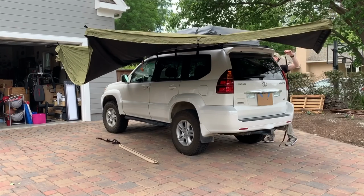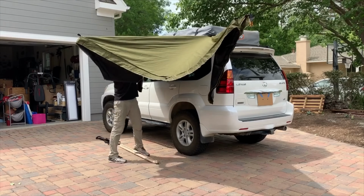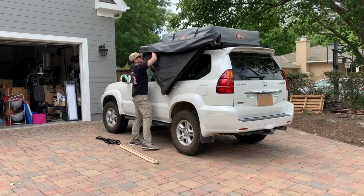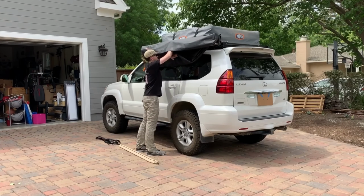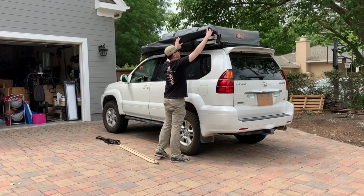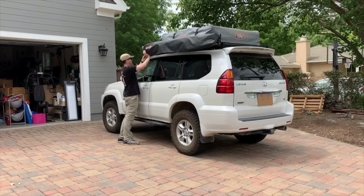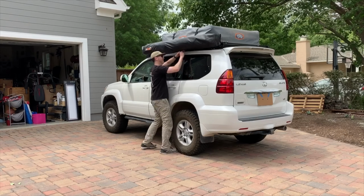There is an order to it, so you've got to obviously take the straps off that are holding it taut. But then in terms of the support bars themselves, you start with the left side because they go behind everything, and then you do the right, and then you just want to make sure there's nothing clumped up. You fold it up like you would a tent, really, and roll it all into the top, and then you take the additional pieces, like the extra support beams, and stick that up there as well, and then you zip it. The only other hint is just put your finger on the back of the zipper as you go along because you don't want it to catch in any material.